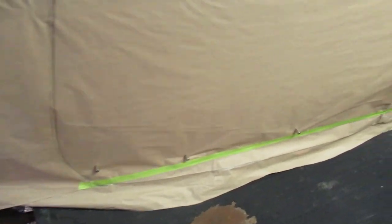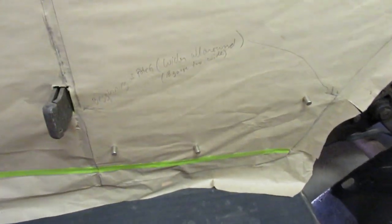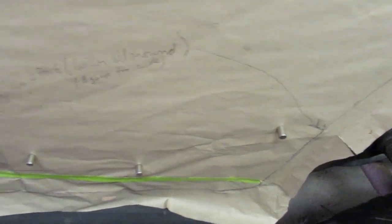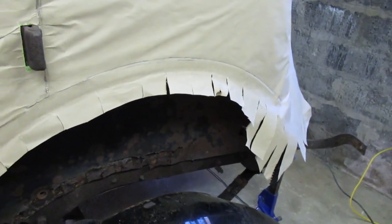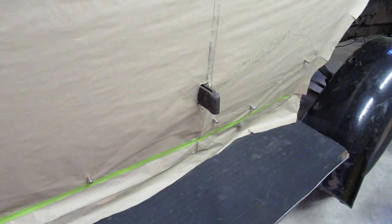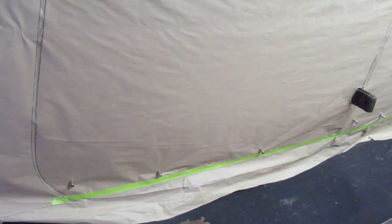It's been a couple of minutes and I've got my trace all the way around — I got the full profile of the door. For the back door I need to remove about an 18-gauge patch that was welded on around the whole bottom piece because it was a bit wide. I've got the wheel opening here and the handle connections, so I'm pretty happy with how it worked out. I think I've got enough metal to do the door bottom. I've got to decide to what extent I do some grinding and investigating to see how much height I'm going to do on these.